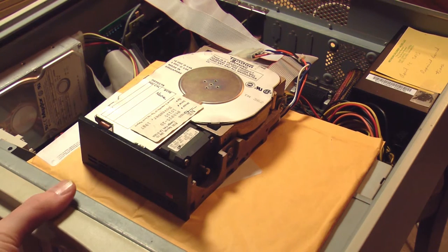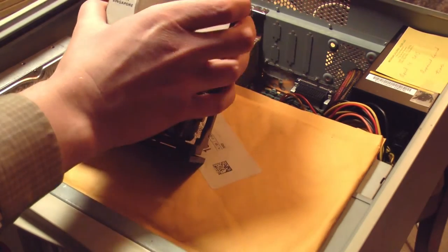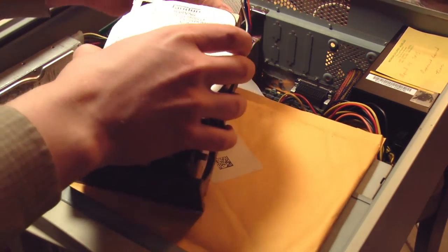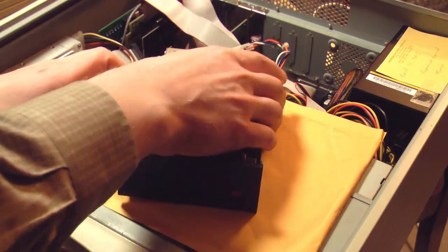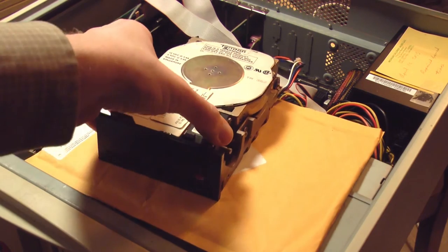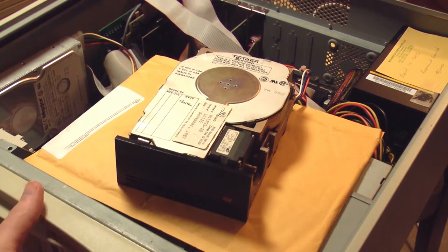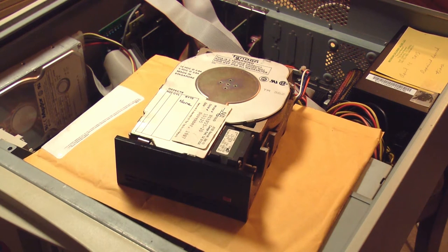So the first thing I'll do is turn off the computer and unplug the hard drive from the controller and just make sure that the controller problem isn't preventing this from starting up. So now I just have power connected. I'll turn the computer back on. And the power supply is good in this computer. Everything in this computer works. I've been using it. Works well.